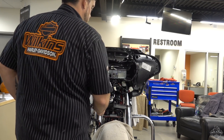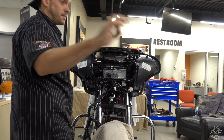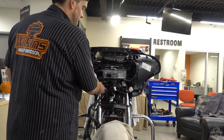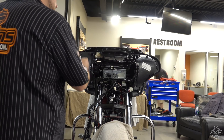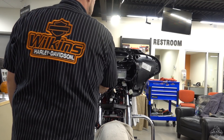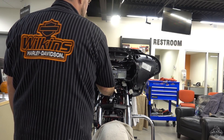Another big difference between the 14s and up is the twist grip sensor. On 13 and below, we recommend upgrading to the Screaming Eagle because it's one solid piece. The stock ones are a two-piece, and there are a lot more wires going to the bars than the earlier bikes because they're not the HDLAN style, and it'll come unplugged. Even if you tape them and you're pulling and pushing, it's easier just to get the one piece. Going to a 14, I've got plenty — you don't really have to extend these.